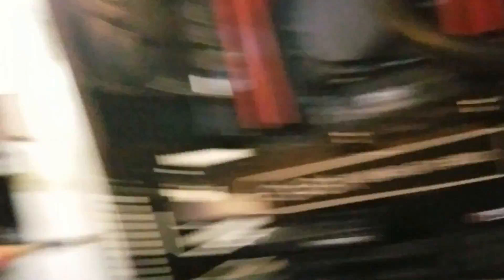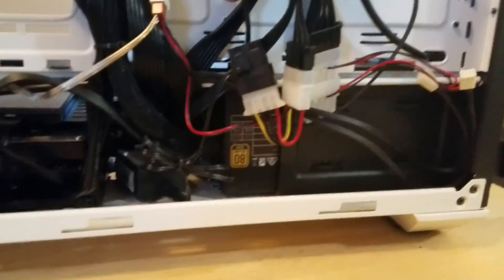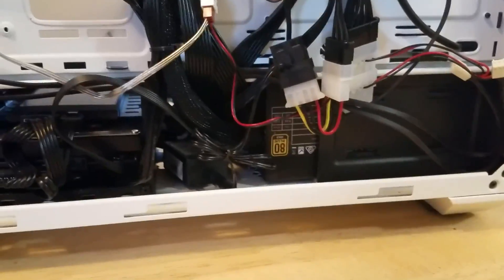There are also some inputs on your motherboard, towards the bottom, and it'll say "fan" right on it. That's what I mean about grown-up Legos — the motherboard will tell you pretty much everything. My issue right now is my motherboard does not support six fans, so that's why I'm going to be installing that fan controller. When you plug your fan in directly to your power supply, your fans are going to be running at full speed all the time, so it's really loud. That is why I want to do this — I just don't want my fans running at full speed all the time.